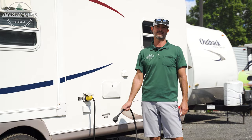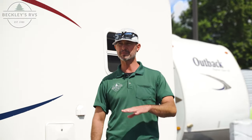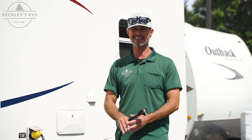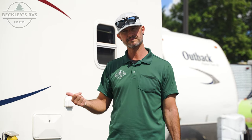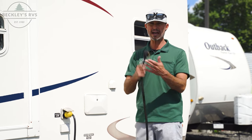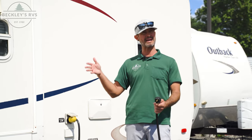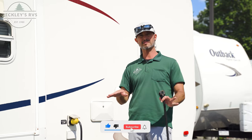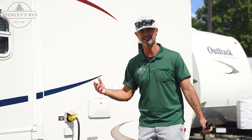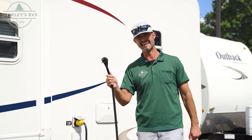What does what? The battery is your weak link. If it is not charged up, not connected, whatever — that kills a lot of items inside. That is your weak link. So make sure before you get up and going, you've got your battery charged up. Electric, when you're at a campground or at the house, anywhere you have power to plug into, the 110 or electric overrides, in a sense, the battery via the converter. Dry camping, you're going to have to rely on your 12 volt. When you're at a campground, you're relying on your 110.